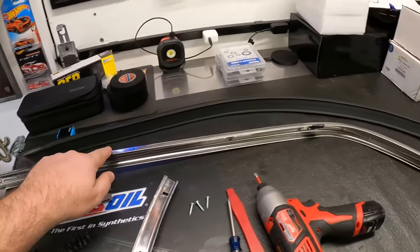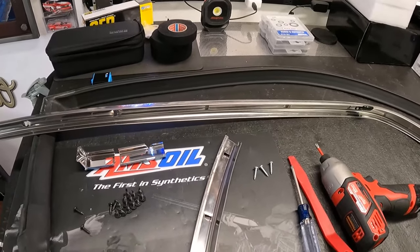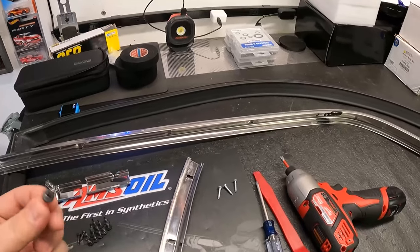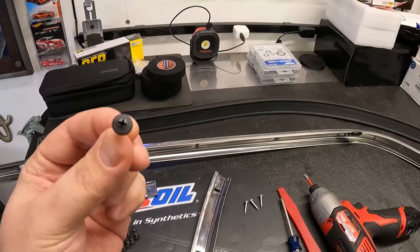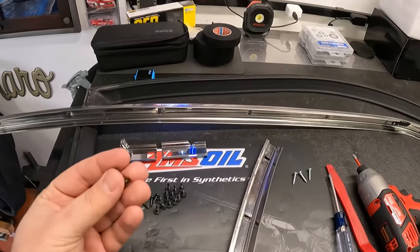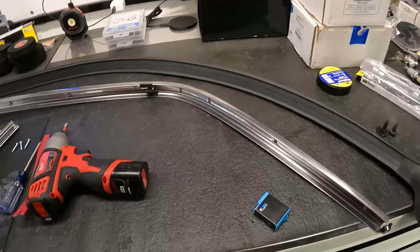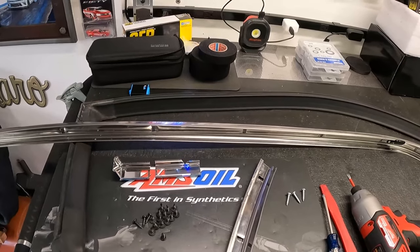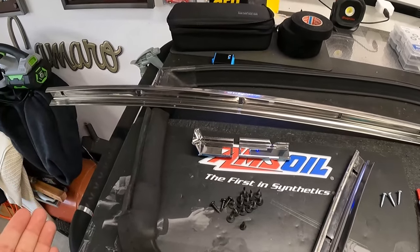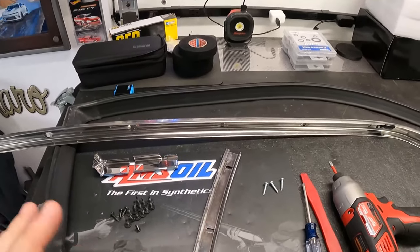The kit comes in a two-piece setup — this is the main rail on the upper part of your window. OER seals or soft seals come with little plastic push pins to hold the piece in place, but I decided to use self-tapping screws — I feel that's a much better way. Most install kits come with everything you need including the screws for the soft seal to mount to the body. We'll also be using weather stripping adhesive to attach the soft seal to the tray, not directly to the body of the car.